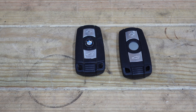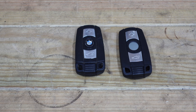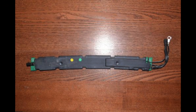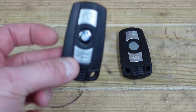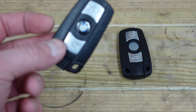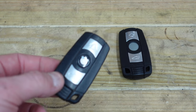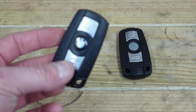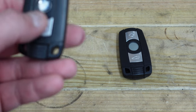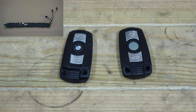A lot of you will find that your key fob ain't working. The first cause is the diversity antenna, which can stop your key working from range, and a lot of people think it's the battery inside. If you've got the problem with range on your key, it will not be your key or the battery itself. The range issue is to do with the diversity antenna — it picks up the megahertz signal from the key. I'll put a picture up of the diversity antenna and link my video above to show you how to locate it.